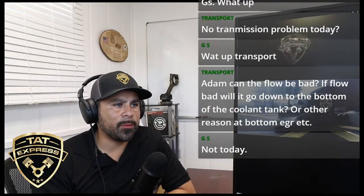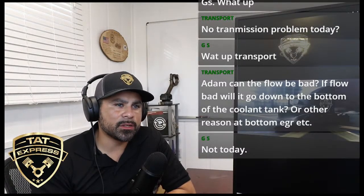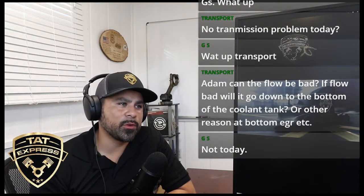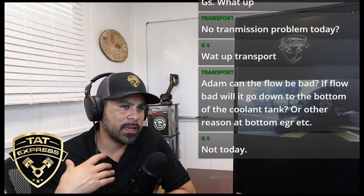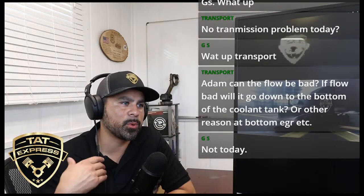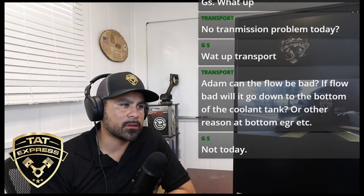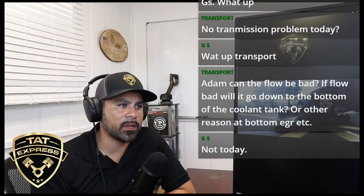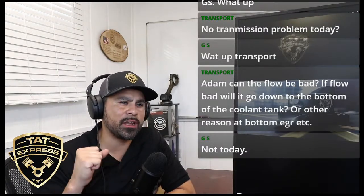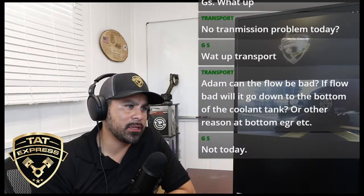DD15 overheating on climbing hills. Why could that be? HG West, thanks for the question, guys. Make sure to ask any questions that you got. Okay, if you're going over a hill and overheating, that's the point where the engine needs the most cooling, or the most heat transferring, because you're putting a higher load on the engine. The first thing I would start with is whether your fan is coming on and going off. You should hear your fan kicking on, blowing hard, and if you don't, and you have a high mileage engine, you should look into that fan clutch.